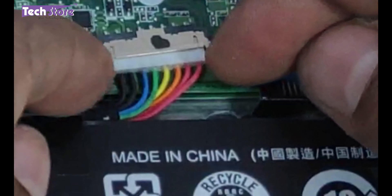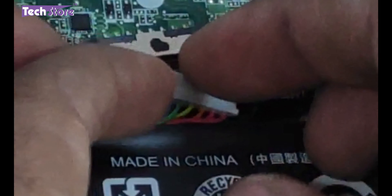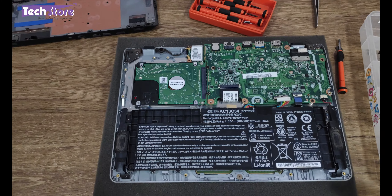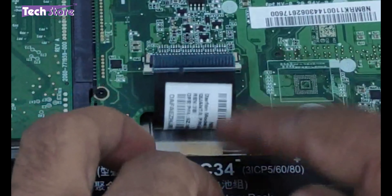You can see the hard drive, the Wi-Fi chip, and the battery. First thing first, we'll have to remove the battery — here's the battery notch, just remove it before starting any operation. This is the keyboard connector; you'll need to remove it if you want to replace the keyboard.